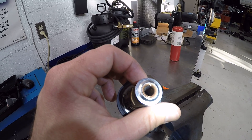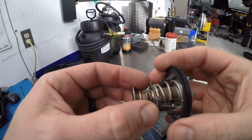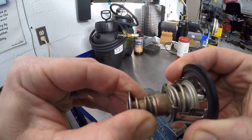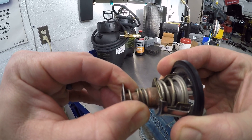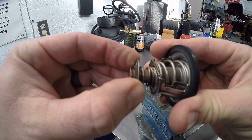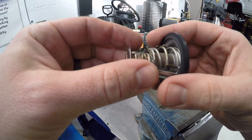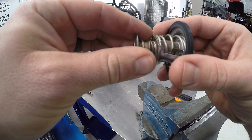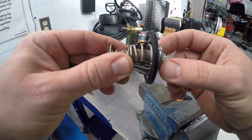You might not be able to see that, but basically when the engine coolant reaches 195 degrees Fahrenheit, this thermostat will open and allow coolant to pass through and circulate through the cooling system — through the radiator. That heat is radiated or removed from the coolant by the air that passes through the radiator, and then the water pump circulates it through the rest of the cooling system until the thermostat opens again.